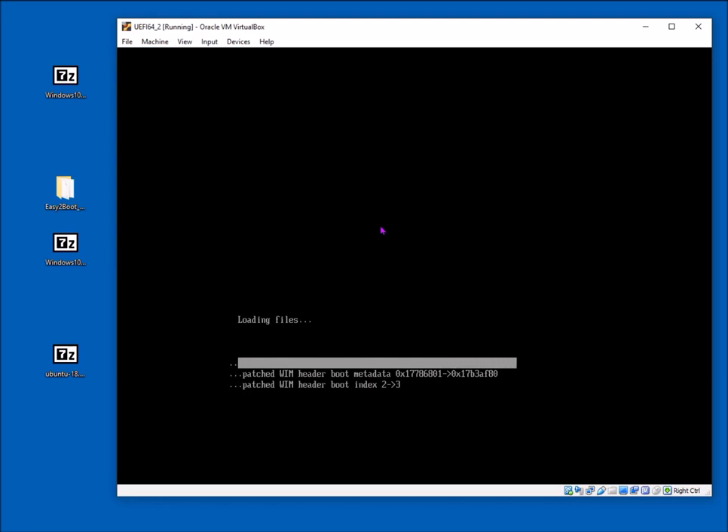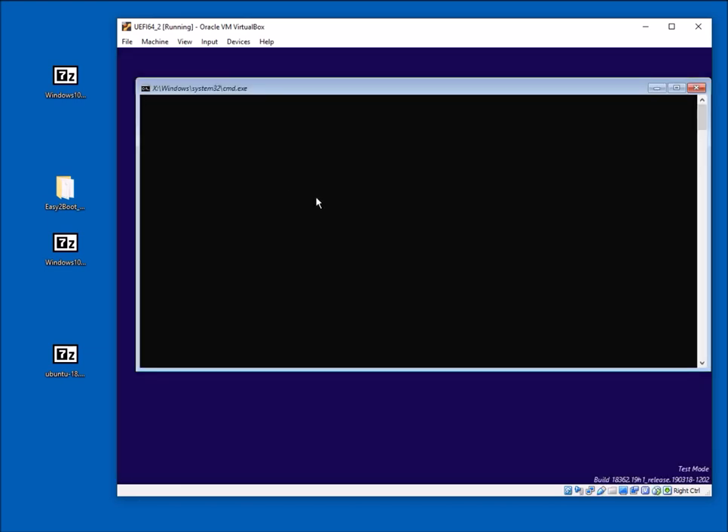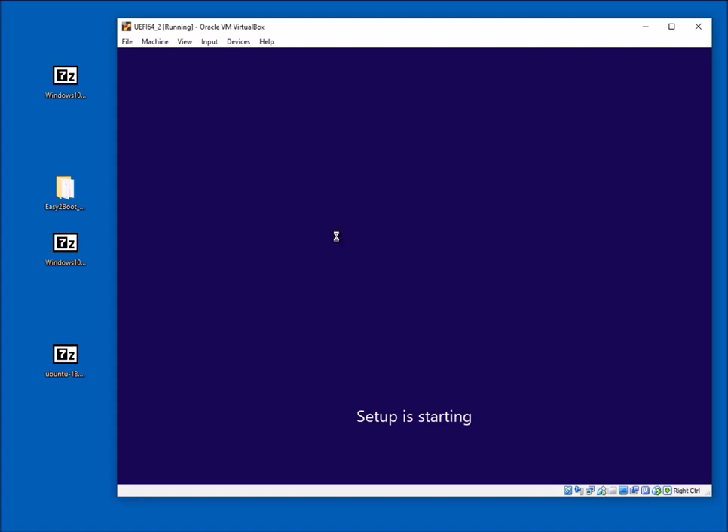You need to use official Microsoft Windows install ISOs — if you use all-in-one ISOs some work and some don't depending on how heavily modified they are. There's really no reason to use all-in-one ISOs when you can just use official Microsoft ISOs — download the latest Windows 10 ISO, copy it into the folder and you're done. This is now booting to Windows 10 setup. A command window opens — it's mounting the ISO file found on the USB drive as a virtual drive.